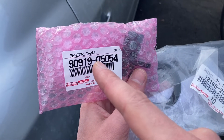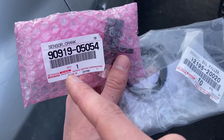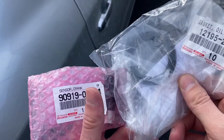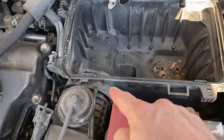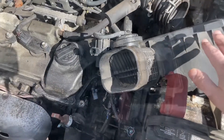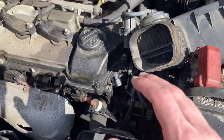Once you remove this top screw and undo the connector, just pull it out — it might have a little resistance because of the oil built up around the O-ring. This sensor is to remedy my P1350, which was coming back immediately after I cleared it, indicating a faulty sensor. This oil cap replacement is to remedy the oil leaking onto the sensor. Make sure to undo the three screws to remove the air filter tray — I just removed the screws and lifted it up to get a working area.